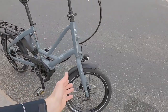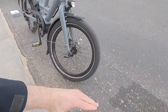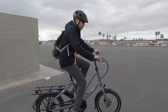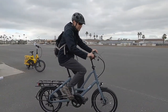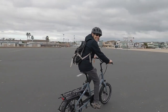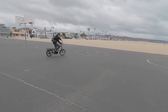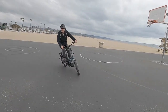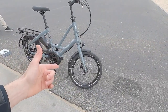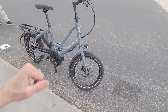In both cases you've got a rigid steel fork — no suspension. With those smaller 20-inch wheels, you have a higher attack angle, so you feel the cracks and bumps a lot more. Tern has done a great job choosing the tires. These Schwalbe Big Apples have K-Guard puncture protection, reflective sidewall stripes, and they're higher volume at 20 by 2.15 — a little bit wider — giving you stability, float, and comfort, though the higher pressure will feel more jarring.